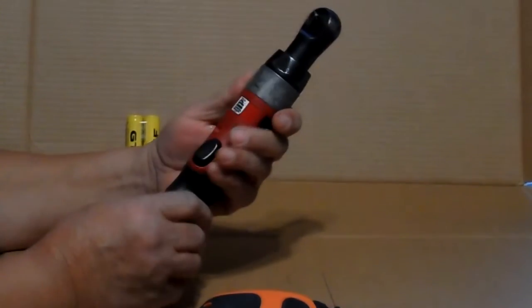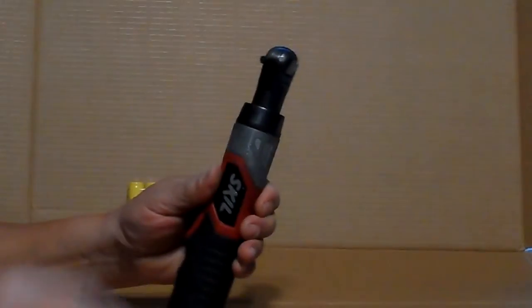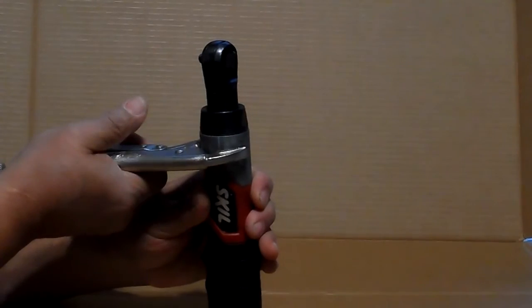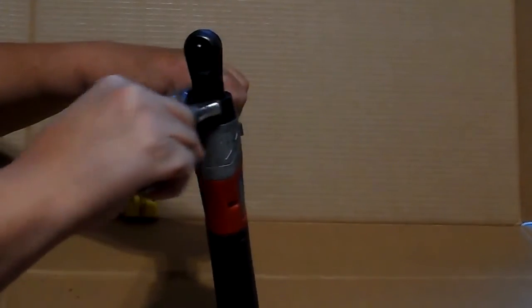Now, to replace the batteries, you still have to get the collar off, which gives a lot of people a lot of trouble. This is how I do that. Hold it with some firm pliers. Get a pipe wrench with flat. Break it loose with a counterclockwise turn.